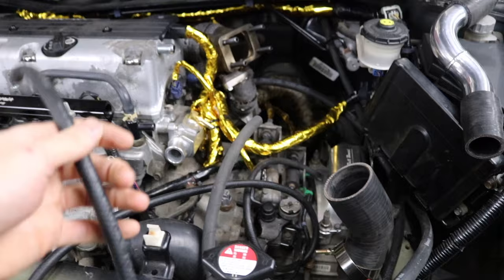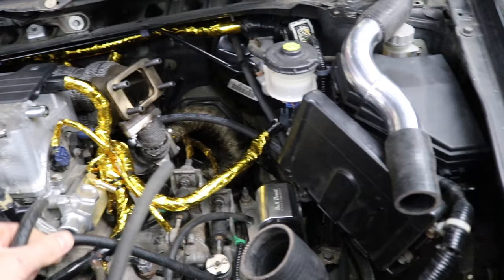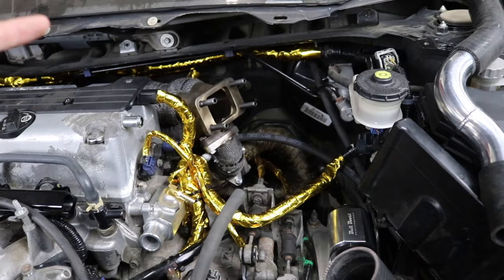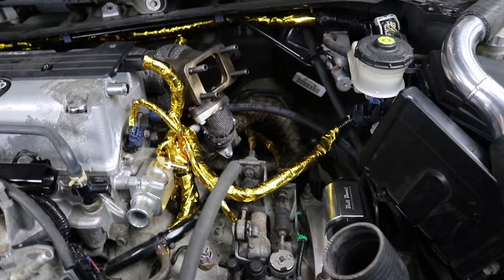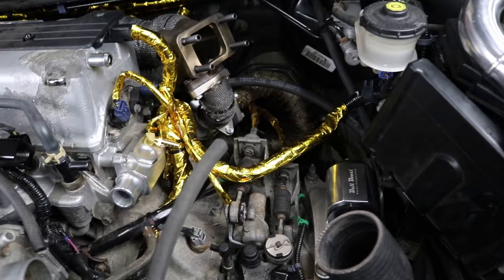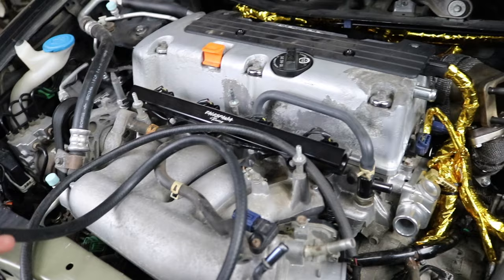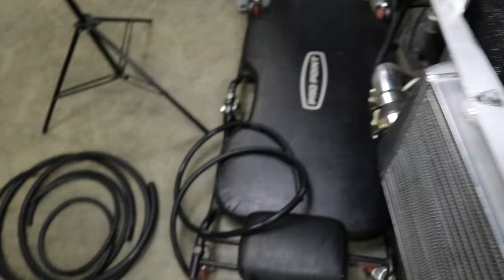It is the next day now. We are back from the store with a whole bunch of hoses and fittings, and I think we got everything we need to finally get this thing together. The first thing I forgot to mention about this kit was the vacuum lines for the wastegate. There are going to be two ports on the wastegate — two barbed fittings — going to the boost controller and to your intake manifold. The fittings on that wastegate from CX Racing are quarter inch. So you could get quarter inch vacuum line, but I'm going to run this quarter inch fuel emissions line — it is a little bit thicker, and I know everything's going to get really hot in that area.